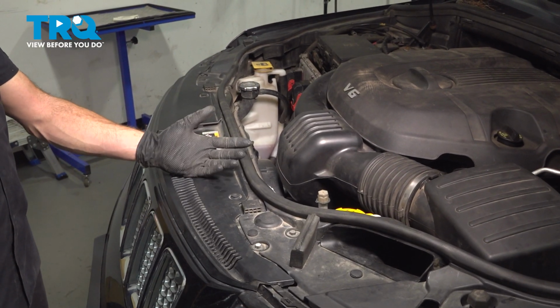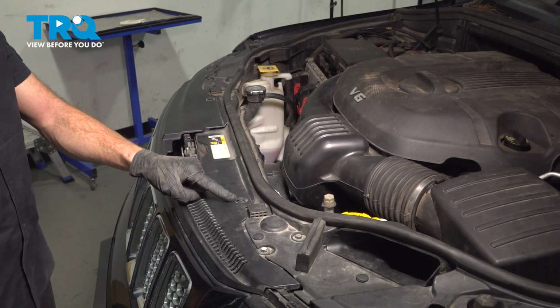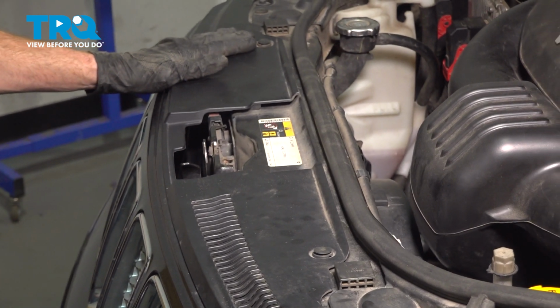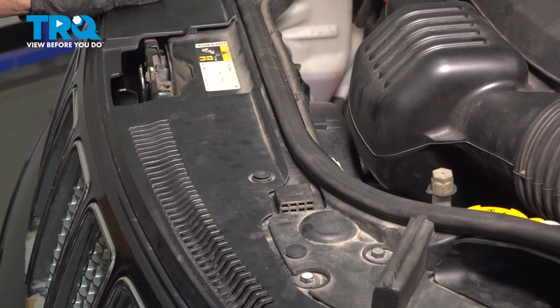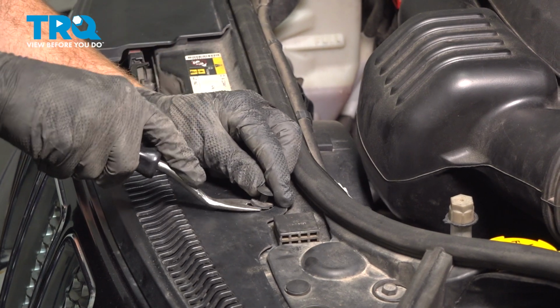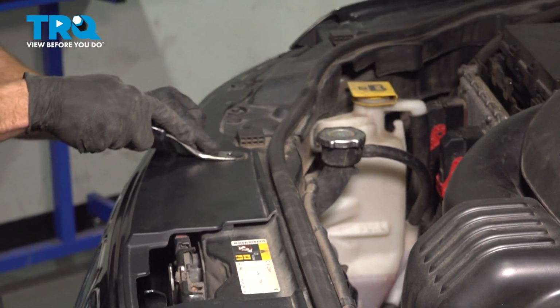Let's make our way back up into the engine compartment. We have 2 more push clips to remove from along the top center. One over on the driver's side and one in the same place over on the passenger side. Once we've removed those, take hold of the bumper cover, we'll give it a little wiggle and remove it from the vehicle. For the push clips, just go ahead and pull out the center. As always here, that's going to unlock it. Quick inspection, move along.